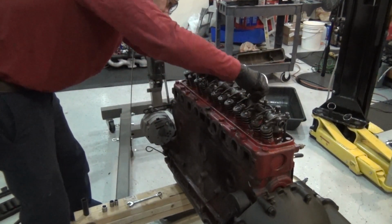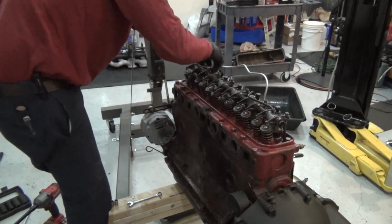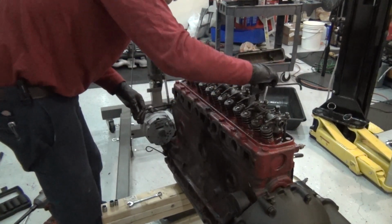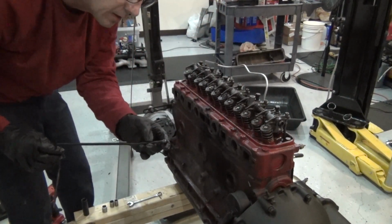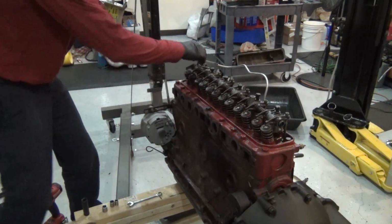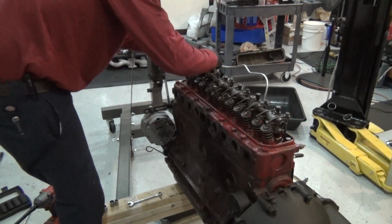this valve carrier off. And there are two oiling pipes that supply oil to this tube right here. And they are on each end right here. And you have to take this bolt out and it holds that little sucker like that. And then you can move this little oil gallery pipe that fits in a hole down there. It's got a rubber seal right there that don't look great either, so that we probably could improve. So this is the rear one, looks longer. And this is the front one right here. I'll take him out too. It's actually a pretty cool system, you know, for oiling. It's not bad at all, the way that Ford invented this.